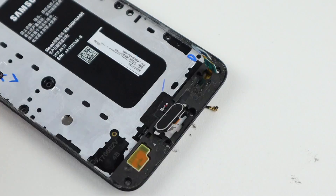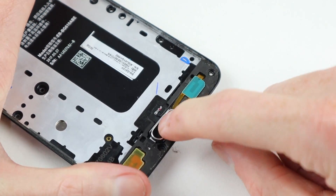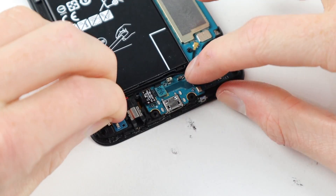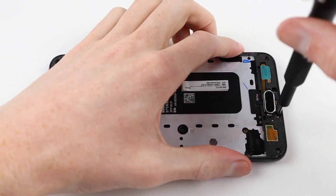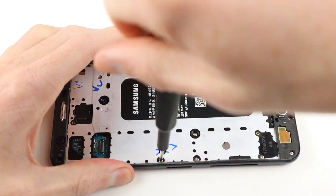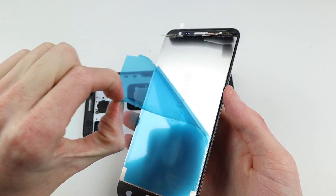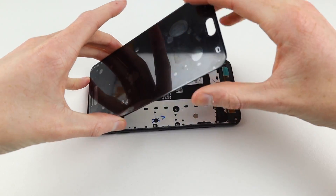Either way it is a fixable mistake. Funnily enough the fingerprint reader still works on this phone even with a broken home button, as it's actually a separate cable, which I found quite interesting. With everything installed I can reattach the little antenna and clip on the back panel onto the J7 Prime midframe. With that fixed, I can reinstall all of the Phillips screws that connect into the midframe.